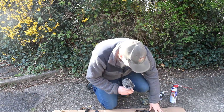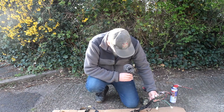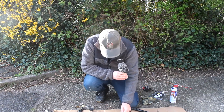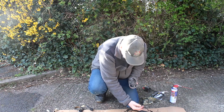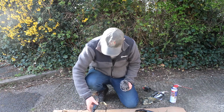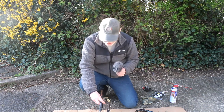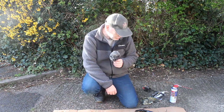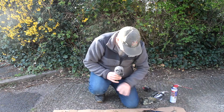Most of this front end here all goes inside the headlamp bucket — a bit of a squeeze to get everything in place. Underneath the tank, the wires go from the handlebar switches into there. Down here you've got all the wires that go to the centre of the bike, where you've got things like the rectifier and the indicator flasher. And then at the back you've got the indicator wires and the rear brake setup. It's pretty simple really — it looks complicated at first, but if you spread it all out, it's not too bad.